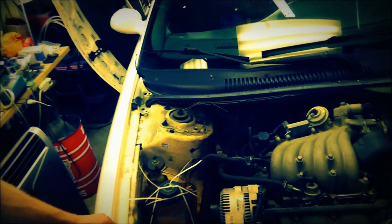The first thing that I had, the cap blew off the radiator or the coolant system right here, and all the coolant came out. Tried to figure out what happened, and got to look in. Looks like the water pump on these engines like to rust out. I do have really nasty brown water and stuff, so that was probably part of the problem. Replaced the water pump, and I also replaced the thermostat, and neither one of those fixed my problem.